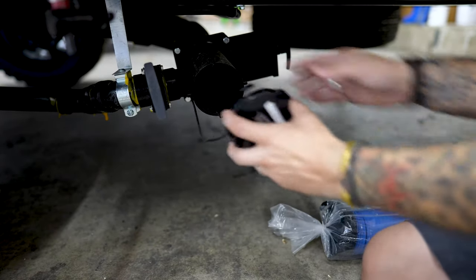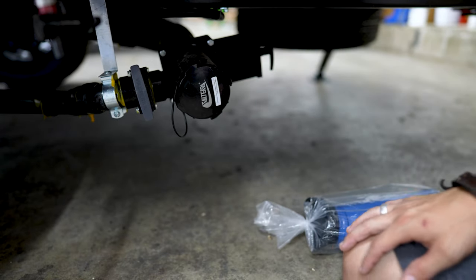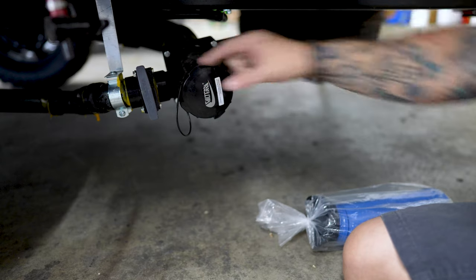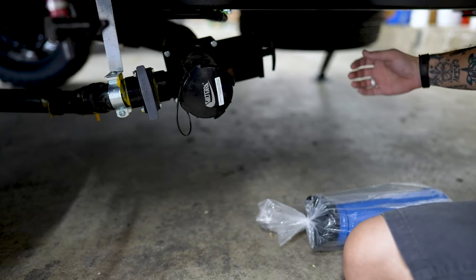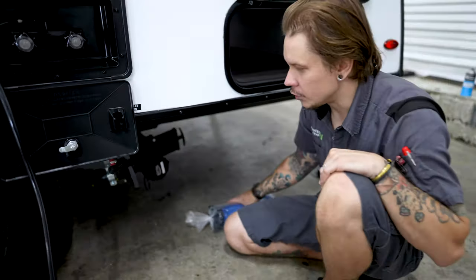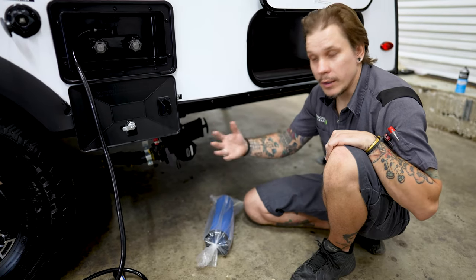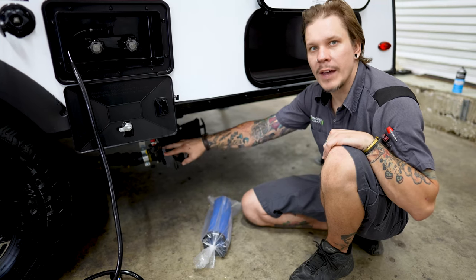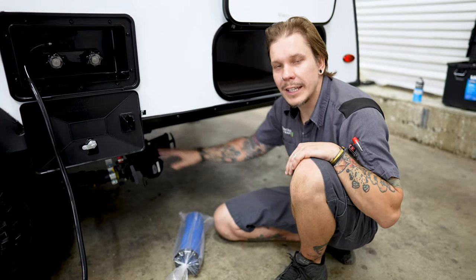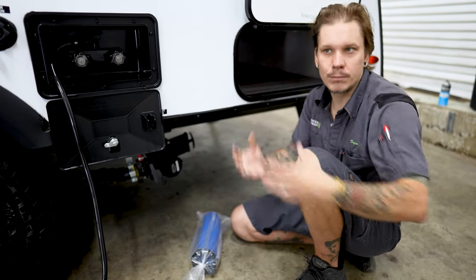Either way, we will put the cap or the sewage hose in the halfway position and rotate that clockwise until these studs are fully engaged. A popular option when dumping wastewater: one thing you want to remember is that these two valves should never be open at the same time. The popular procedure is dumping our black water first, and once we are satisfied it is empty, we close that valve. We then open up our gray water — that's going to rinse any shared plumbing between the two systems as well as rinse our sewage hose on the way out. Most importantly, these valves need to be closed during normal operation. We have a monitor panel on the inside that will indicate the levels. Specifically with the black water holding tank, we want to keep that waste in as wet a condition as we can so that when we go ahead and relieve the tank, it does easily evacuate the unit.